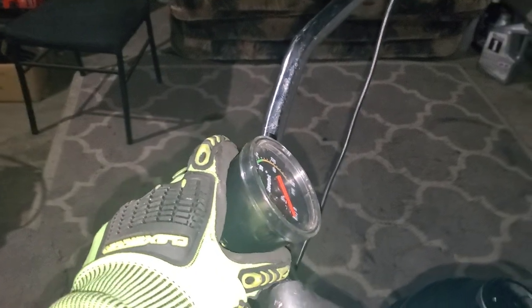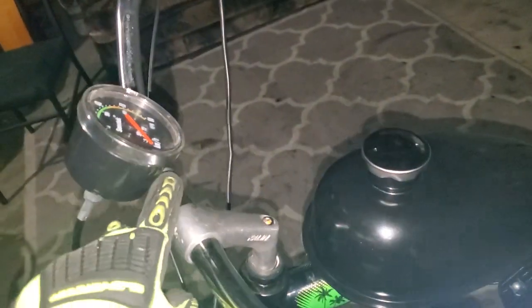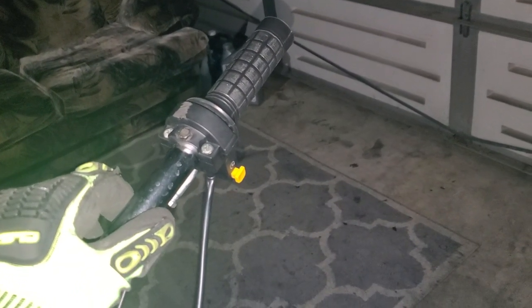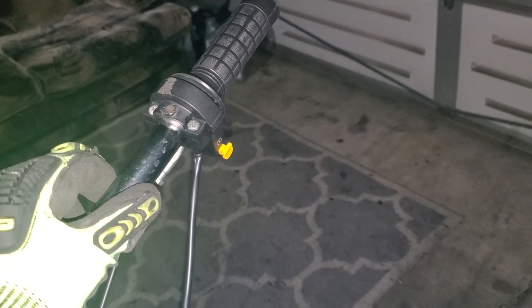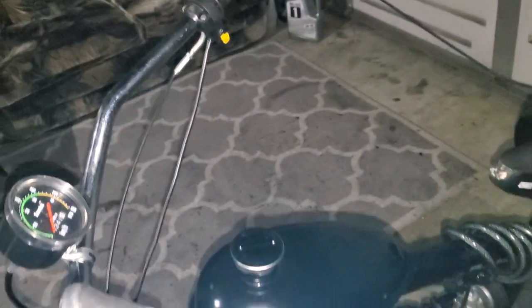I kind of reattached this speedometer here for you — that should be good. I got a little chunk of rubber up underneath there. I put this bolt down in here to keep this from slipping around. This grip was getting kind of loose. The pin that fits into the plastic underneath there was starting to get that hole wobbly, wearing down, and that thing eventually just fails. So I just put that extra bolt in there to keep it from turning as you're working the throttle.